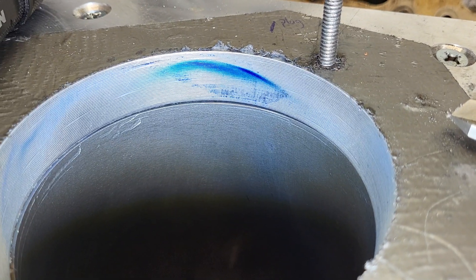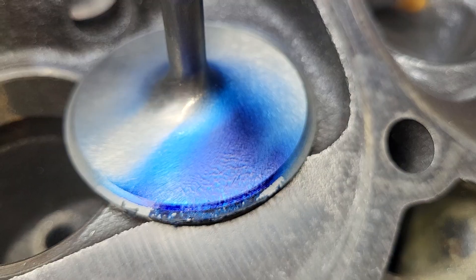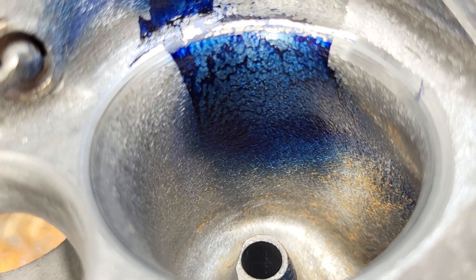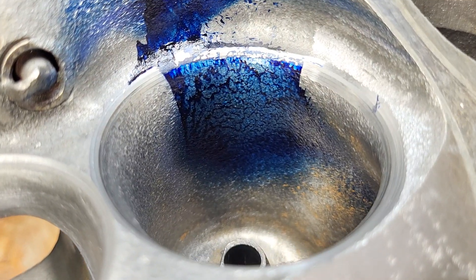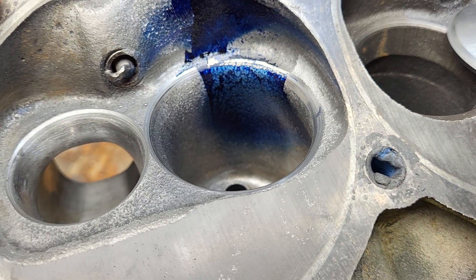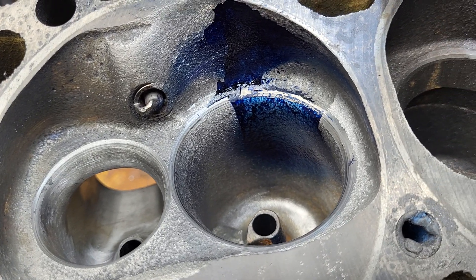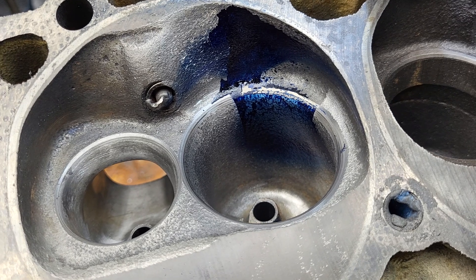Let's take a look at the bore. Not nearly as much in the bore because I didn't get to finish spraying. Let's see what it looks like down its throat. The valve actually looks quite good, but you have to remember it was snapping closed while I was spraying. This looks very much the way it did last time, except it has moved over this way some more — not necessarily bad. It's a bigger valve, so a little piece of the chamber had to come out for the top cut. It does change the dynamics a little bit, but it's still a very tight throat — only about 88% on the throat, and it's a 45-degree seat.